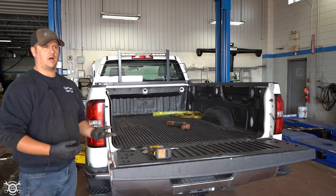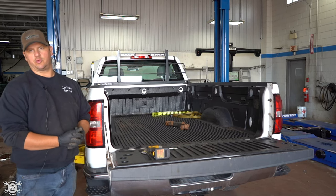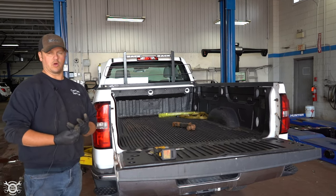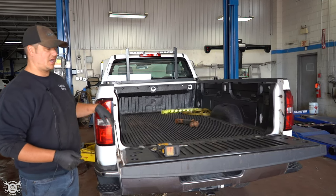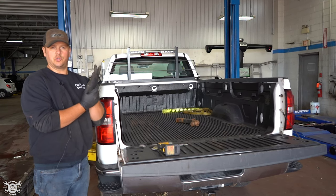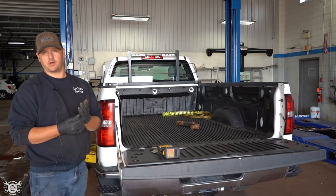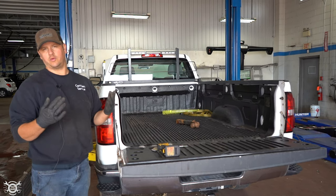That's pretty much how to replace bulbs. Make sure your hands are clean. When you're taking it apart, take notice of what you're removing so when you put it back together you just do the reverse order. Make sure you've got the right bulb before you get started — especially if you've got to remove an air box, bumper, or grille — and obviously test it when done. If you replace the bulb and it doesn't work, you've got a circuit problem — it could be something as simple as a fuse, which we discussed in the last video, or it could be a bad wiring issue or a bad switch.